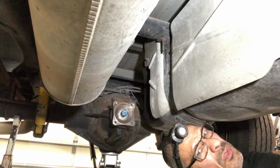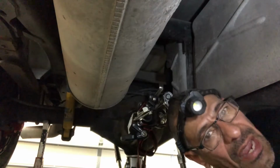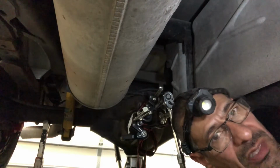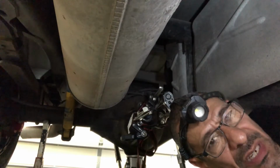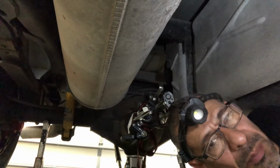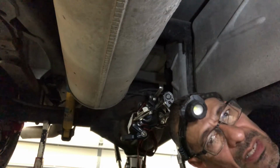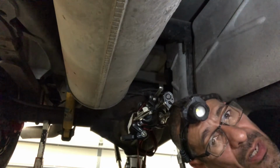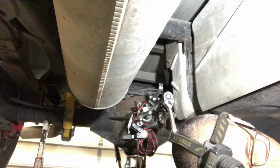I think I got another tool. Hold tight. So it's taken a while. The way I have it, I got a ratchet strap around the 3-jaw puller just to keep the claws together because the claws were slipping. And once it starts pulling out, they loosen up just a tad bit. The claws do slip, but I just have to readjust it. Not really tighten it, just readjust it, and I start getting another bite, and it starts moving. So I've done it a couple times, and I've pretty much almost got it completely off. So let's watch a little bit. Maybe on fast forward.